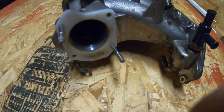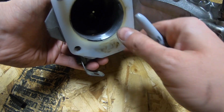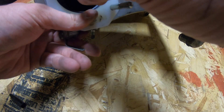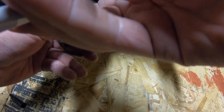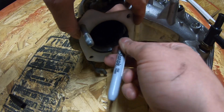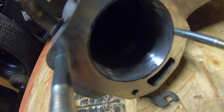What I am going to do is take just a sharpie or a marker, and I am just going to mark with the gasket pressed up against the intake manifold — I am just going to mark on the inside. If you get any on the gasket it is fine, it will all come off with rubbing alcohol. Kind of wiggle the gasket around because you never know exactly how you are going to make up the throttle body. Wiggle it around, keep marking, pull it off — you can see the black marker line all the way around it.